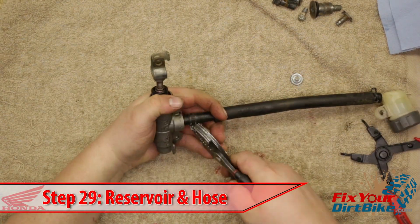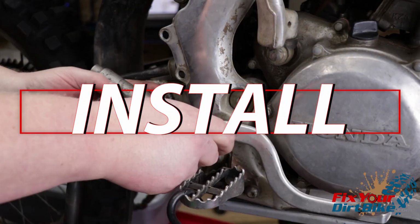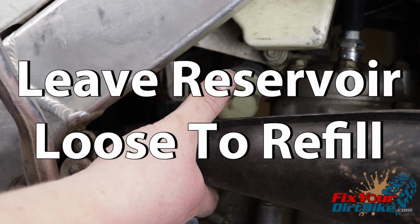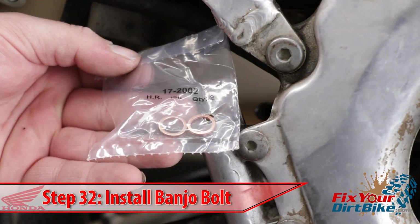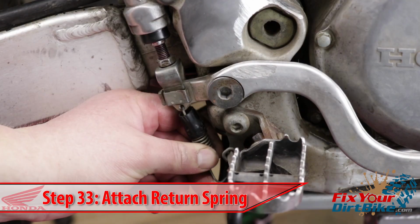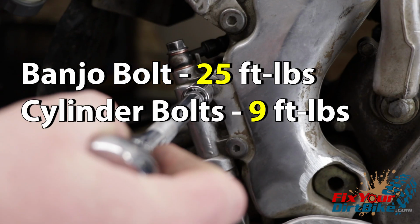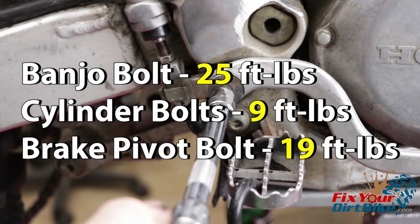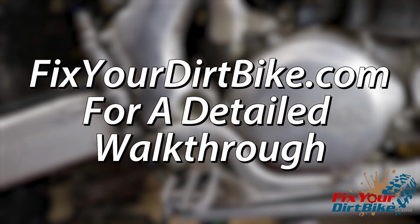Assemble and install the reservoir and hose. Reassemble the brake lever and clevis with the new cotter pin. Install the brake lever and the master cylinder, then push the reservoir into the frame. Do not attach the reservoir, you will need access to it when replacing brake fluid. Install the banjo bolt with new seal washers and reattach the return spring. Torque the banjo bolt to 25 foot-pounds, the master cylinder mounting bolts to 9 foot-pounds, and the brake lever pivot bolt to 19 foot-pounds.